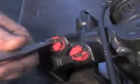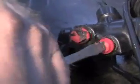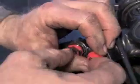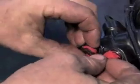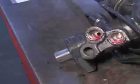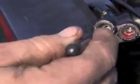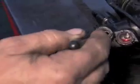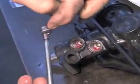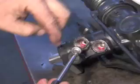We're going to take the plugs out of the new gear, and we're going to see if it came with a valve already in it, because if you didn't know that was in there, you flipped your old one out and went rolling across the floor, you get the new one and compare it to the old one, neither one's going to have a valve in it, and it could be put in without that in there, and then it's not going to work. So we've got the plugs out of it, and if you'll look down in this hole, you'll see that the new unit did not come with the valve in it, and that could have got somebody in trouble. You'd want to put this in with the shoulder thick end out, and it goes in the hole closest to the shaft.